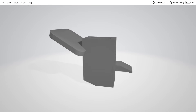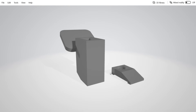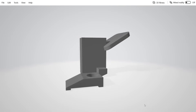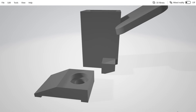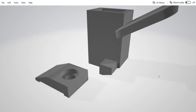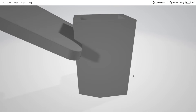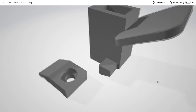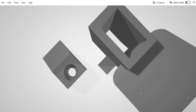What this is, is two pieces — one fits over the throttle, you take the knob off and slide it down, and the other is a little block. That block has a slope so that when you move the throttle up from idle, cutoff, or reverse it can lift itself over, and when you pull it back from high power to idle it catches on the little ramp. The beauty is there's no springs involved — gravity does all the work and it's fairly easy to install.